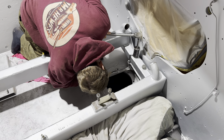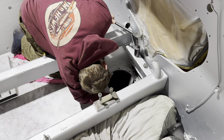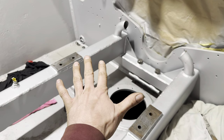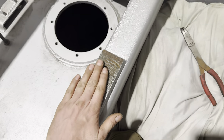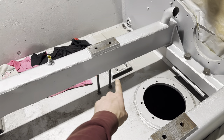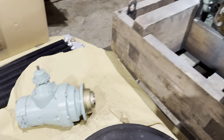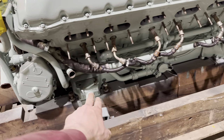That's the engine water rail all bolted down nicely now, with split pins and the nuts underneath. I've dropped the bolts down so the engine can go on — you can see why you have to put those bolts in first because you can't get them in otherwise, not unless you cut the floor out, which would be frowned upon. So, engine time. The starter motor is off with all the nuts and bolts back on there, and they are shimmed, so we don't want those shims coming off. I've unbolted it from the crate.